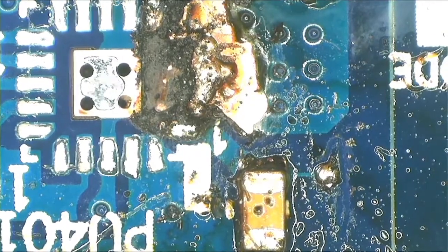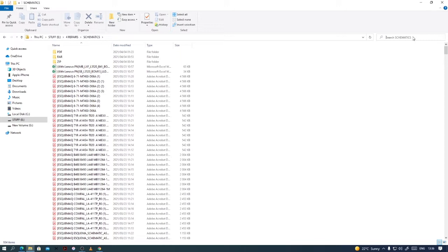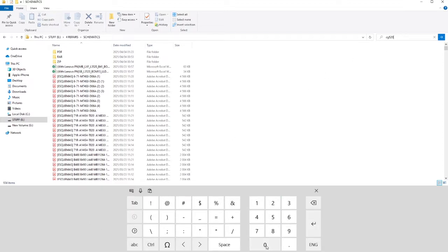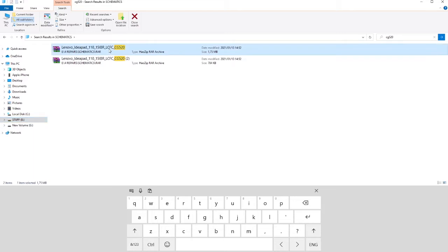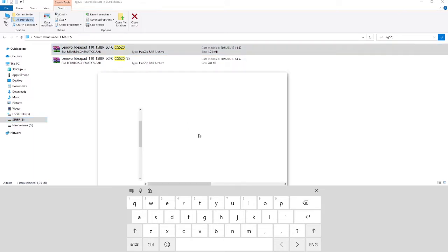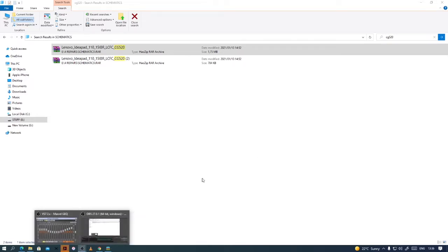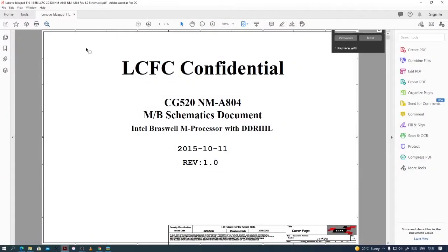I'm not sure whether this is five volts or three volts, but we'll go ahead and check the schematic. What I did was I have a hard drive with all the schematic BIOS files and more. Let's look for this — type the port number. In our case this is CG520. Okay, let's search CG520 — there it is, we have the Lenovo schematic. Let's check the chip number. The chip number is PU401. Let's go ahead and search for PU401.